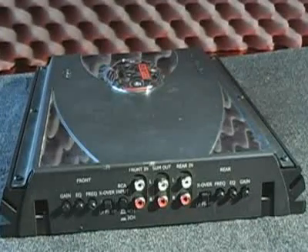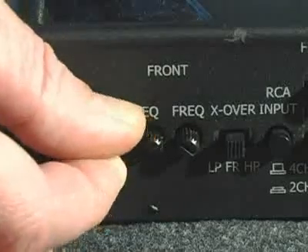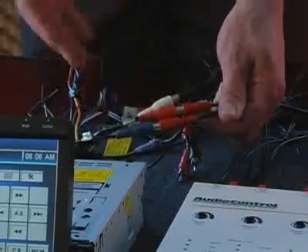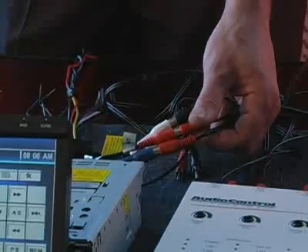This means that to get good volume, you must now turn up amplifier gains and suffer from increased background noise and reduced dynamic range. This problem is at its worst in multi-channel AV systems where the RMS signal level at the amplifier is often less than 1 volt.